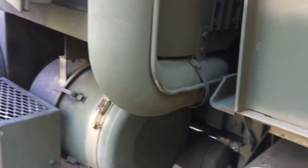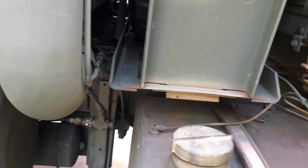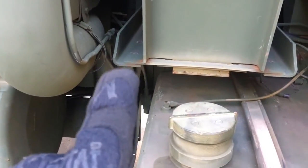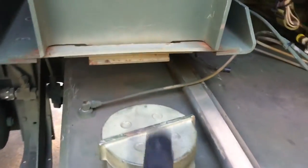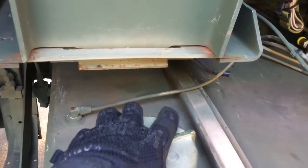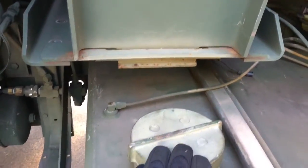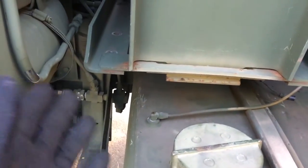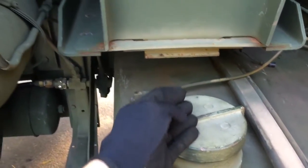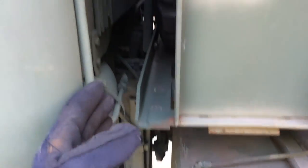This is your vent line for your fuel tank. It goes down and feeds into the T for the two vent lines, and that is how you pressurize your tank if you don't have a valve stem in the gas cap. I don't have a valve in my gas cap and wasn't going to put one in today. Somebody recommended this way and I figured we'd give it a shot and open up that option for people who don't have a valve stem. It worked, but not exactly as people explained online.